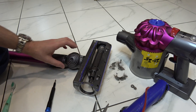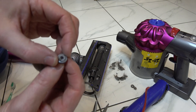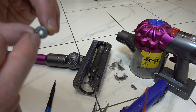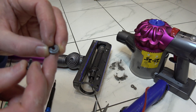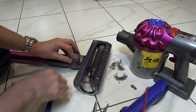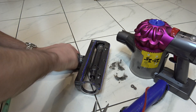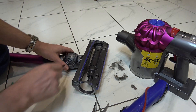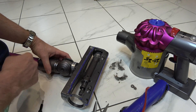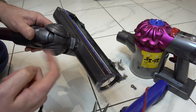Right, so that's nice and clean. Put that back on here and then we have this screw and this washer bit here. You can tell which way it goes around because one side is just smooth — the other side has these little teeth, so make sure the teeth marry up with the teeth on here. Okay, and now I've done that up as tight as it needs to go. You can see it's spinning nicely now — look at the difference between the two sides.